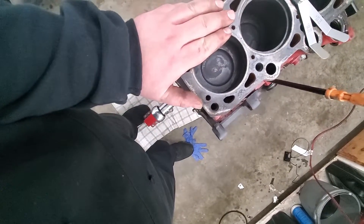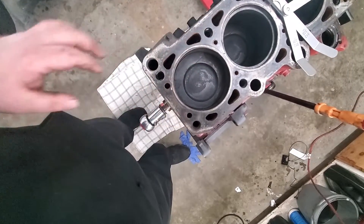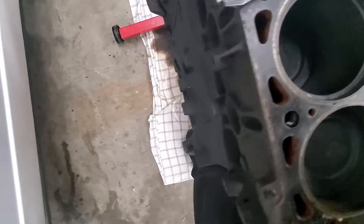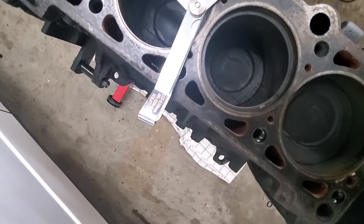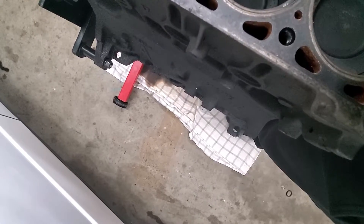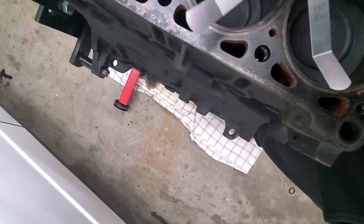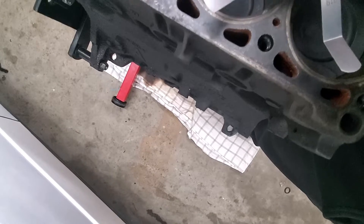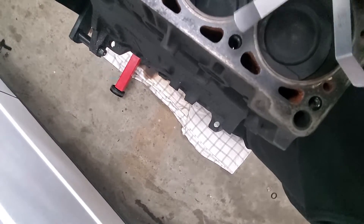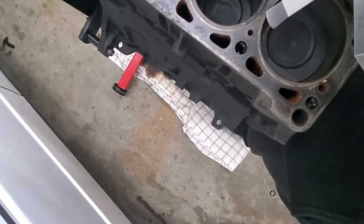I got most of the motor already apart and I'm about to get the pistons out. I'm working on the piston rings right now. Here's one of the new piston rings, and now I'll show you what my problem is. As you can see here, it should be between 12 and 13 — normally it should be like 11.89 something.